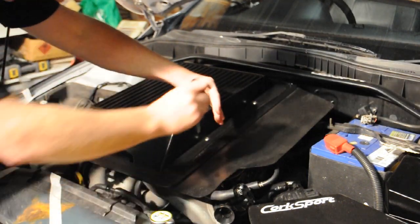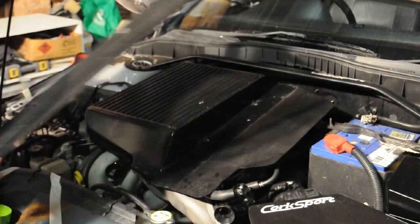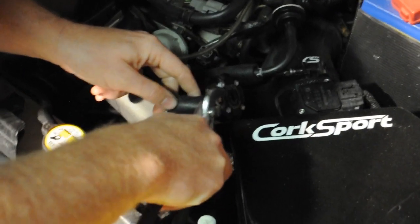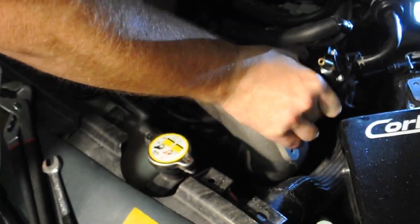To get to your intake manifold, you've got to get access to it. So we're going to take off our intercooler. This is a standard shroud, although this is a custom intercooler. Then take off your blow-off valve by removing the hoses and a couple of screws, and that comes off. If you need a more detailed video on this, you can click the link below.